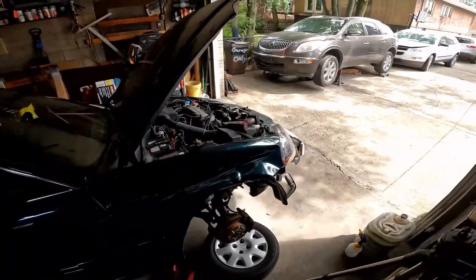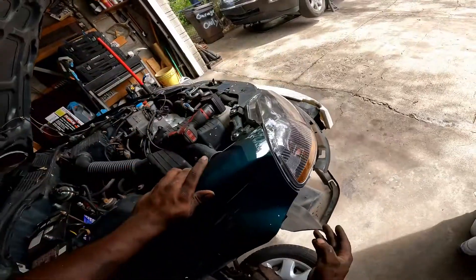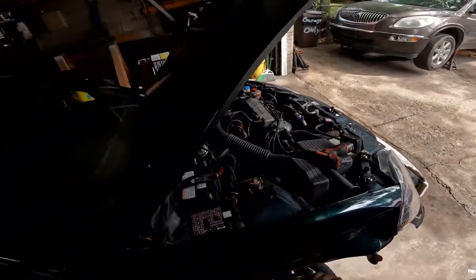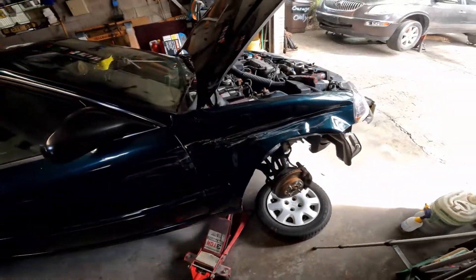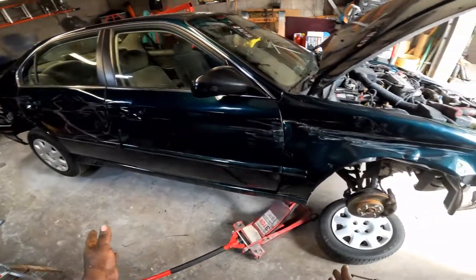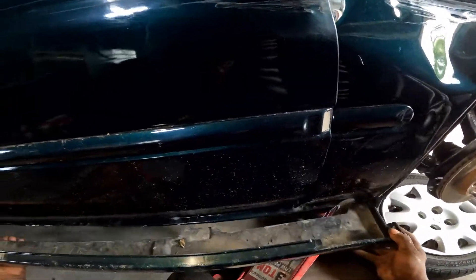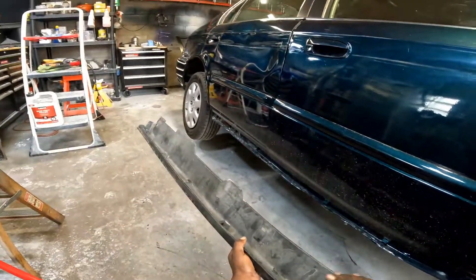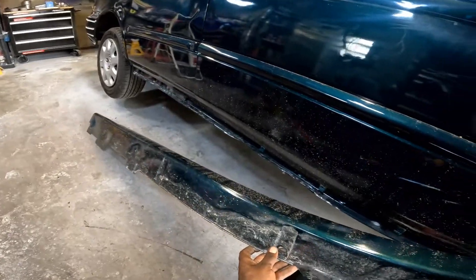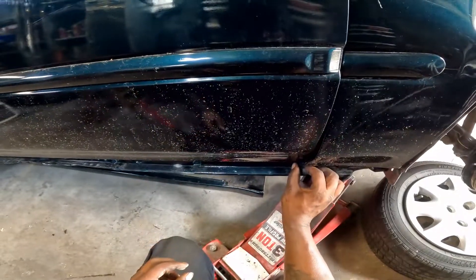The reason why you have to remove the bumper is because there's a bolt here and another one up under there that you must remove - that also gets into the headlight itself. The headlight did take a little damage. Now I gotta get that side skirt off. Side skirt should easily be removed - you just gotta slide it forward. There we go, she comes right off after you remove the clips that hold it at the bottom.